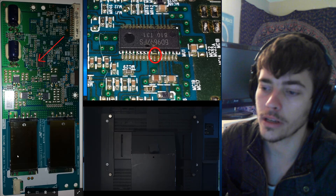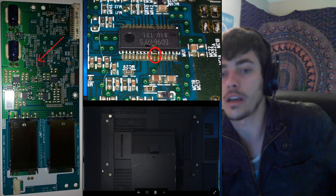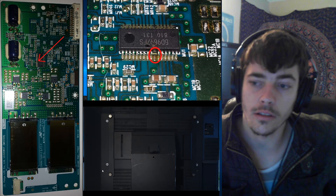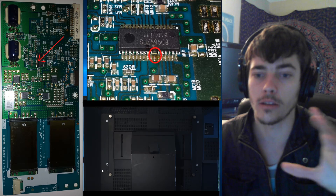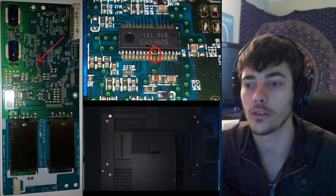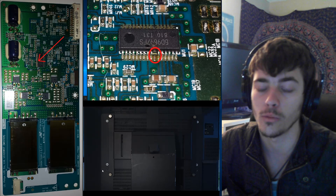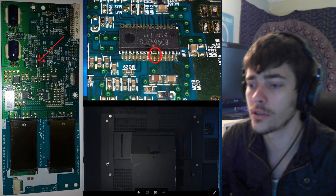The reason this might happen to your TV is that there's a board inside that controls your backlight. Even though the LCD panel might be producing color properly, if the backlight isn't working it's going to look like the screen is off and you won't be able to see anything.